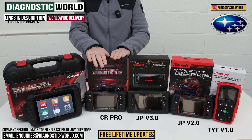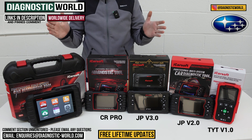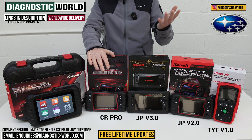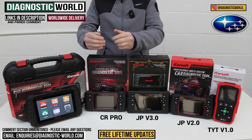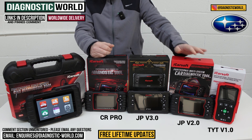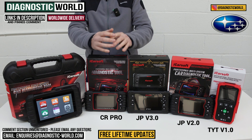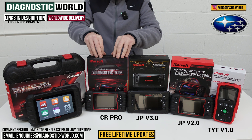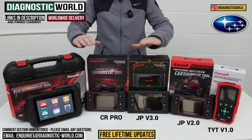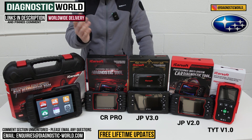We then come to the CR Pro Kit. This has been a good seller for a number of years purely because of the scope of manufacturers it covers — a huge range. So if you've got a Subaru but you've also got a BMW, Mercedes, Land Rover, Porsche, Ford, or Volvo and you wanted a tool that caters for all of your vehicles, then the CR Pro Kit is definitely a good option. It matches the service functionality of the version 2.0 tool, giving you the ability to do DPF regenerations, electronic parking brakes, ABS brake bleeding, and injector coding across a huge range of manufacturers.